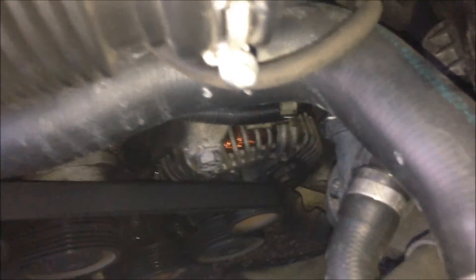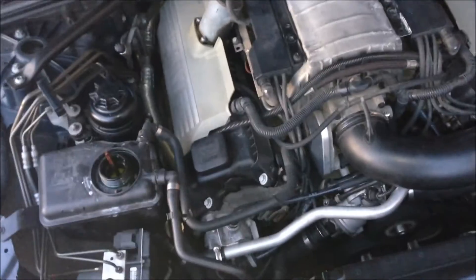Alright, so I assembled everything together. Everything is running fine — I don't see any leaks anymore. I'm gonna check my fluid level for a couple of days. I just started the car like five minutes ago and I don't see any leak. Some people told me it was gonna be the big transfer pipe inside the engine that was leaking, but it turned out it was the water pump. That was my first water pump replacement of my 2004 BMW 545i. Thanks for watching guys.